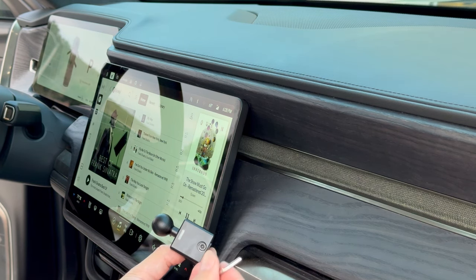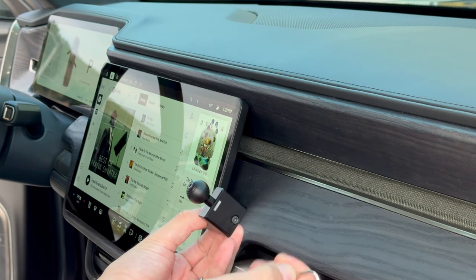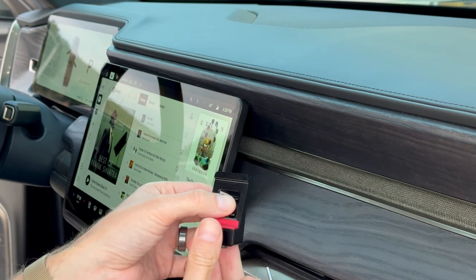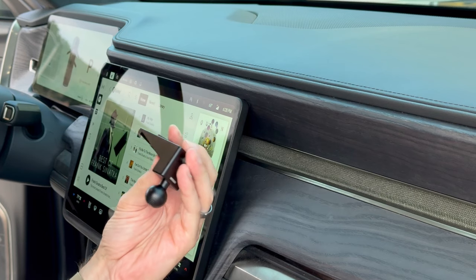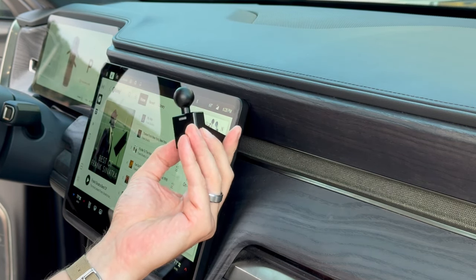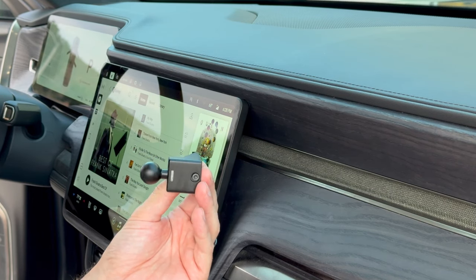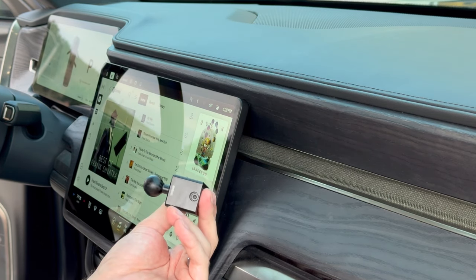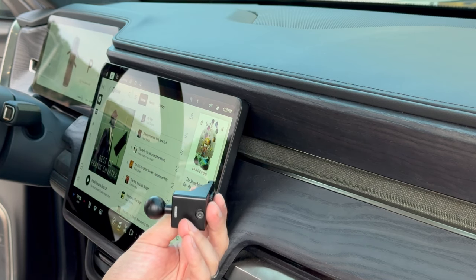There are three easy steps. The first step is to open up the mounting base — we're going to back out the screw such that the center portion starts to float and slide freely. This is also a good time to have a close look at the mounting base itself. It is a fully metal piece, machined from aluminum and black anodized. It's got a molded rubber elastomer to protect the contact area, so if you ever have to remove this, you can do so without leaving any evidence it was ever installed.